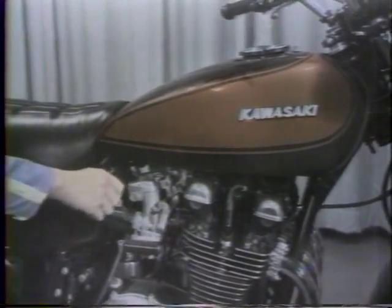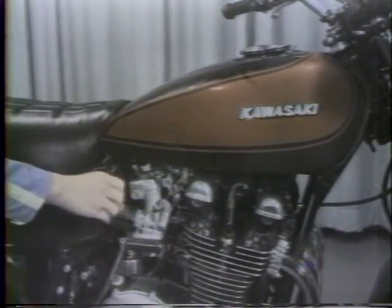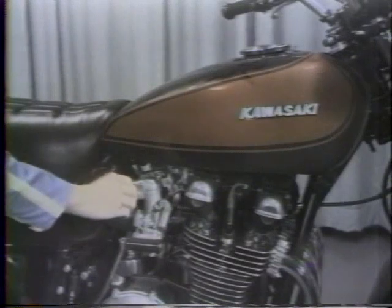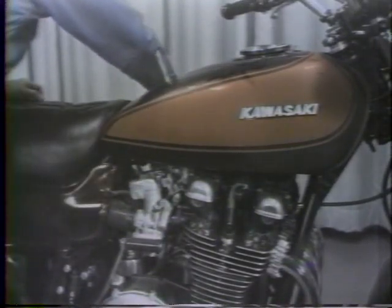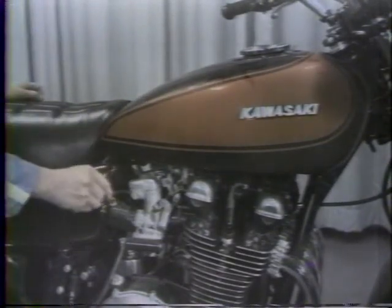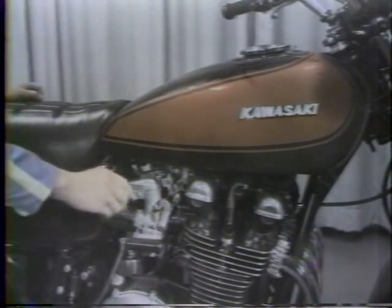Adjust the air screw of each carburetor, one at a time, first turning it in one direction and then in the other until the point of highest idle is determined. If idle RPM rises too much during air screw adjustment, lower it with the main idle adjust screw. If any carburetor air screw can be turned into less than 1/2 turn from full in without idle speed changing, there is probably trouble within that carburetor.